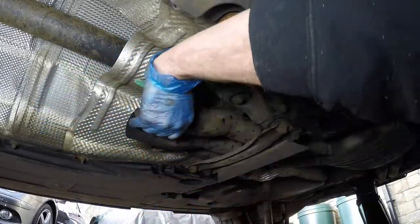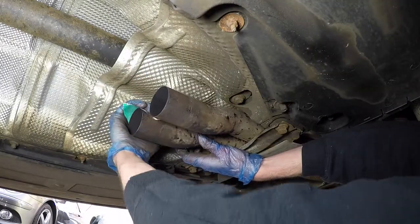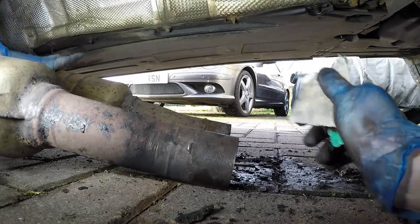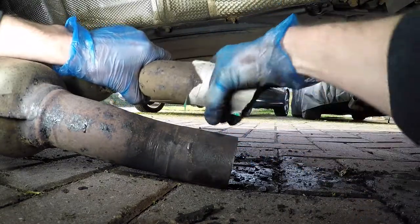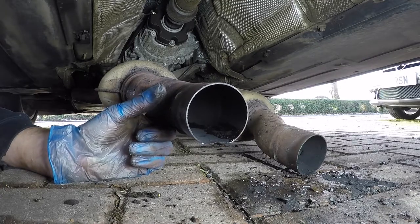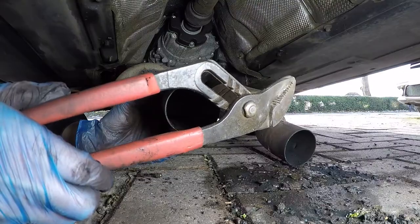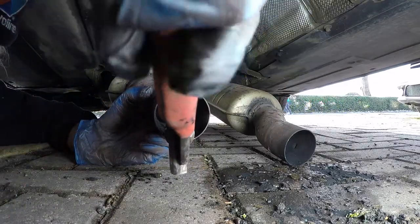There's a little bit of prep to do on the car as well — here I'm sanding the exhaust pipes themselves to ensure the sleeves slide over more easily during installation. Also, one of my exhaust pipes dropped slightly when the exhaust clamp failed, leaving a small dent, so I'm going to straighten that out using some grips to make sure there's no restriction to the exhaust gas flow.